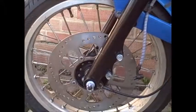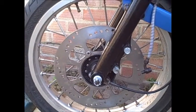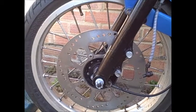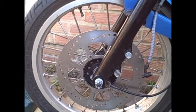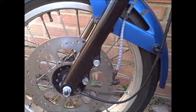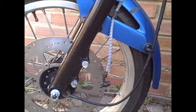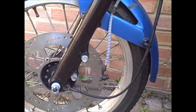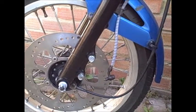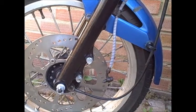I've got an uprated front brake. The disc is actually from a Honda FMX 650 - it's slightly modified to fit, but not much. I'm waiting for a caliper; I'm going to use a Honda NC30 caliper. I'll have to make an adapter bracket to suit.